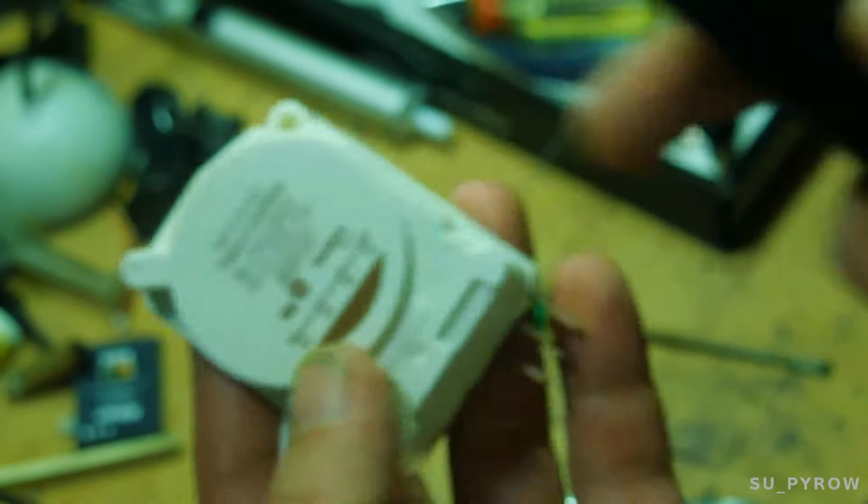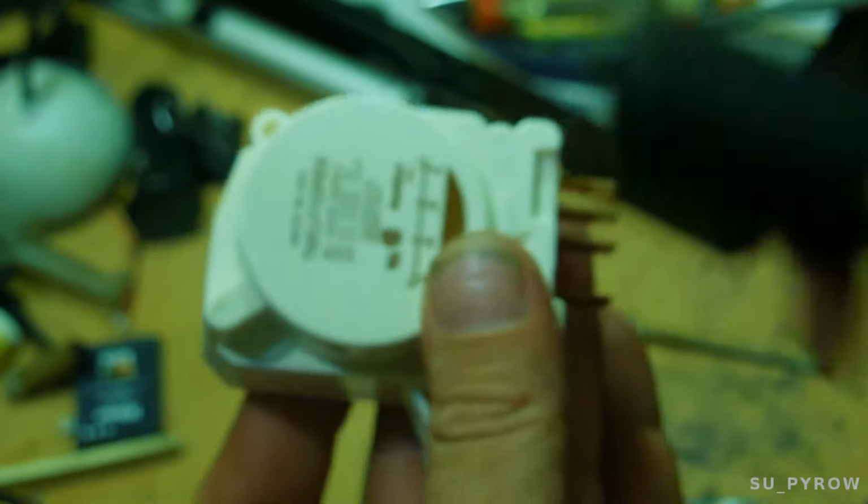It's the mechanic's stethoscope. You put your screwdriver up to the device, and you put your ear on this end of the screwdriver, and using the magic of vibration, you can actually hear the inside of things. And you can try that with a lot of different things. Just make sure you don't get hurt, because this will be energized while you're testing this. So you don't want your screwdriver to come flying down it.